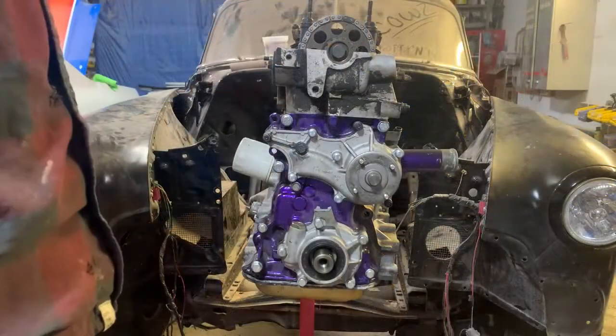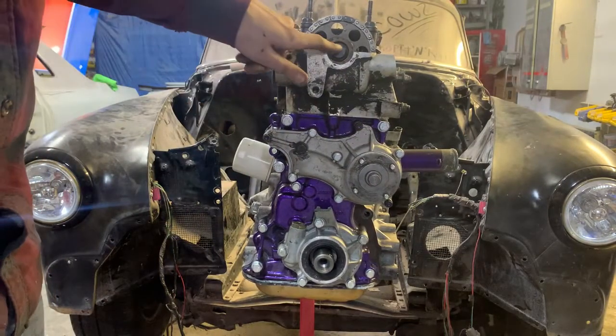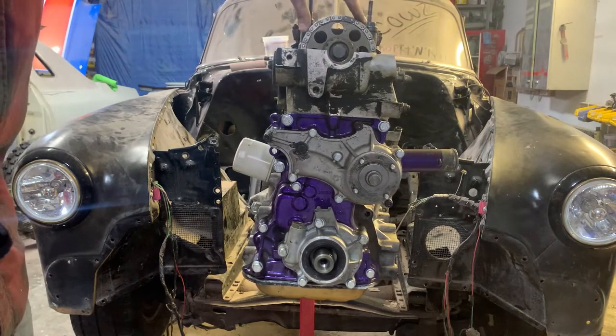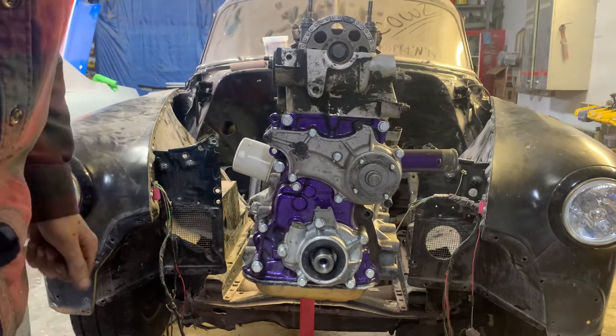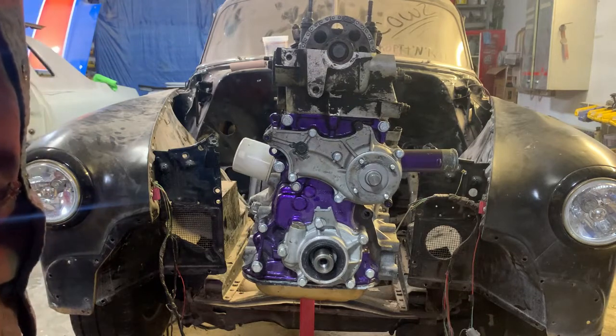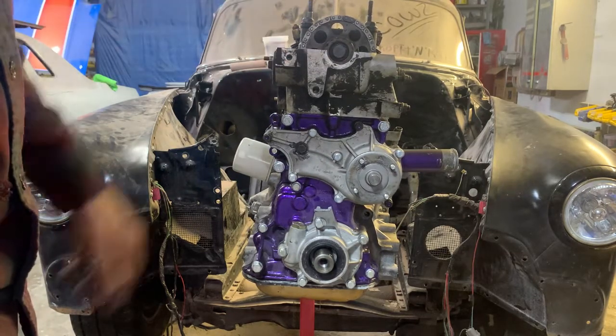Yes. Now, make sure you get this bolt in up here. You can pull this cam bolt out and pop this off. This will stay on there because it's got tension on it. And you push your bolt down in there and snug it up real nice. Put some RTV over the head so that oil doesn't go down in your threads and potentially blow your head gasket. And you slide your cam bolt back in.